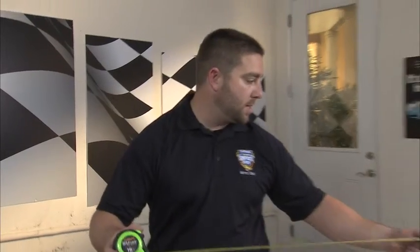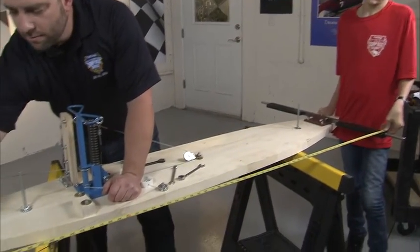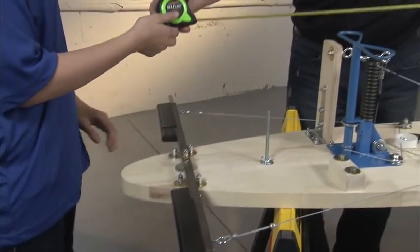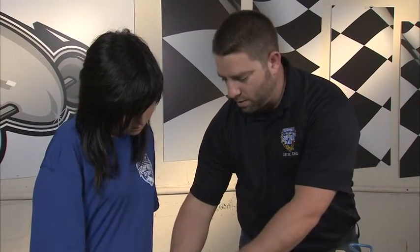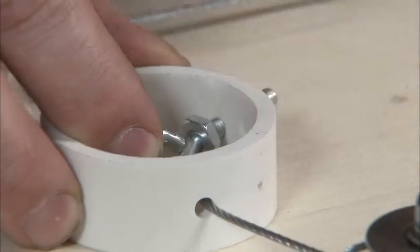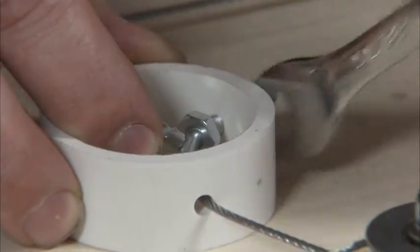Time for the front axle alignment. Hook the tape over the back axle and check the measurement — that's at 63 and a half. You can look right down on the tape measure to make sure we're being precise. Now let's go to the other side, making sure that our steering wheel stayed centered. We are off — we're only at 63 and a quarter here versus 63 and a half over there. That means we need to increase the tension on the left side of the axle, which is going to pull the axle back a little bit. That eighth inch can get us into alignment. Tighten or loosen the steering cables at the cable adjuster eye bolt until the length is exactly the same on both sides.